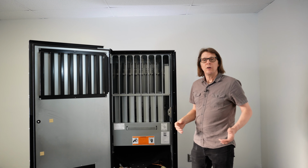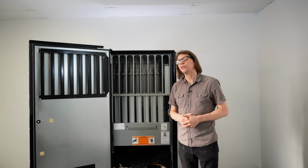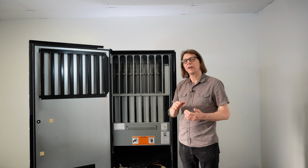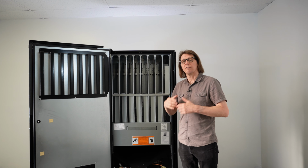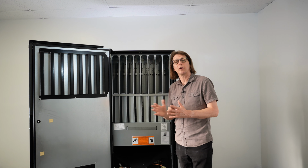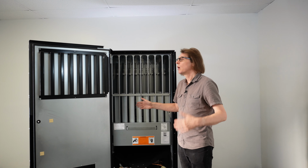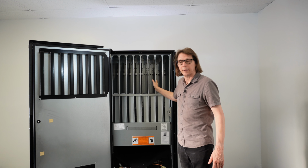Now on Vendo 721 and 621 series machines, for a 12 ounce can, you can actually load these 4 deep per selection. So that means you're going to have 4 cans going from front to back in the machine. So again, 4 cans deep. We have a back spacer inside this machine that needs to be adjusted to accommodate that different length of packages. Since we're going to be putting 4 cans deep, we're probably going to have to use this back spacer here and have it adjusted all the way back.